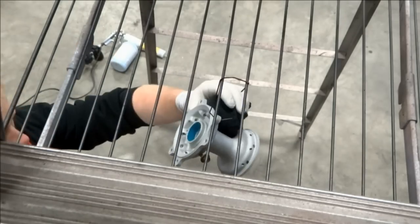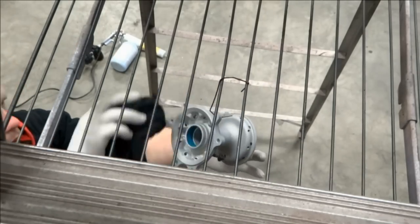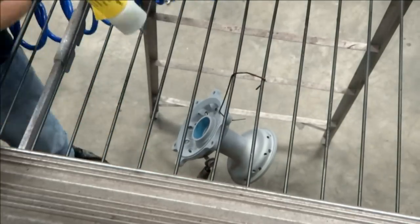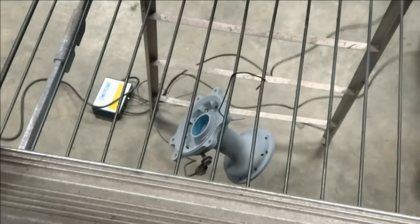Once it's out and cooled, you can spray the chrome base. The chrome powder is hard to see over a sandblasted surface, so make sure to take your time and spray from every angle.